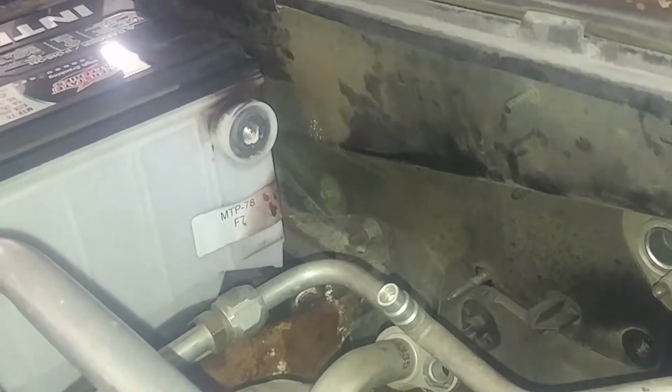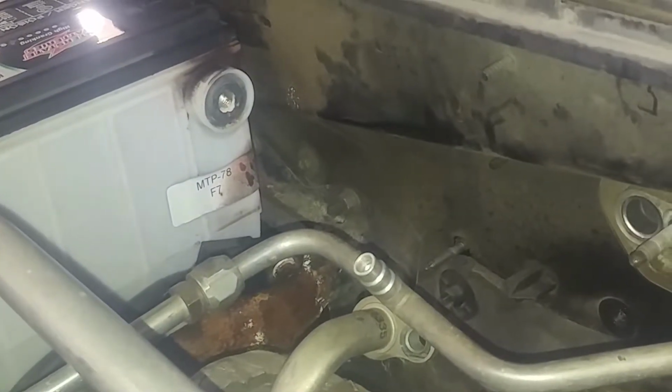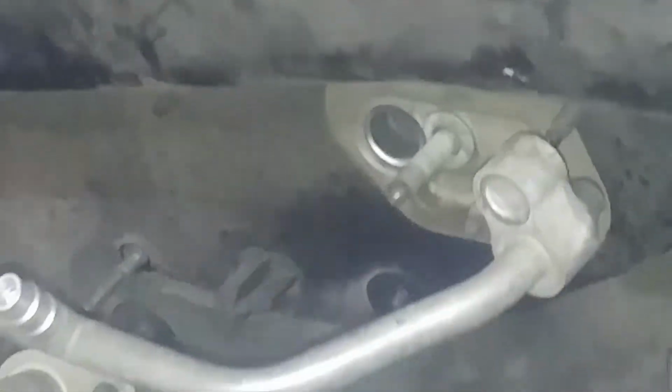You can see the other one tucked away here in the nice padding insulation. So you probably get that with a swivel and a 10 millimeter. I think I can get it like that. Otherwise, a 10 millimeter socket and a 1/4-inch ratchet will get it out. So there. The last one might be behind the battery there. 10mm bolt. Those are my last two.